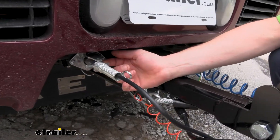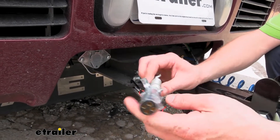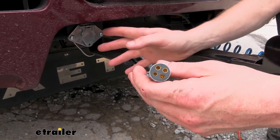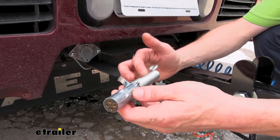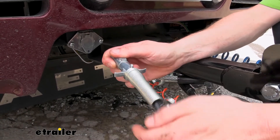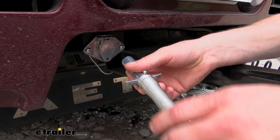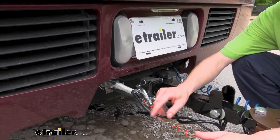At the front it is a four-round connector used in this setup. It also includes the four-round female connector that goes on the vehicle side if you need that for your motorhome. Four-round really isn't the most common you're going to see on the back of a motorhome for a flat tow setup, but you can get adapters here at eTrailer, or you can easily hardwire that in. It does feel very heavy duty — this is a nice strong metal with no plastic ends, all metal on that side as well. This cable relief is really nice because that's often the most common place for failure — where a cable comes out of the back of a connector. The strain of the weight, especially going down the road bouncing, that's where you get failures. With this nice spring mechanism, that's going to support the cable so we don't get that issue. But it still has flex so we can move it around as needed. Really heavy-duty cabling — that's probably the best part of this magnetic light kit.